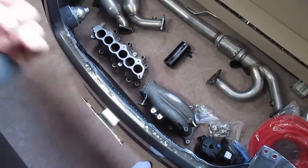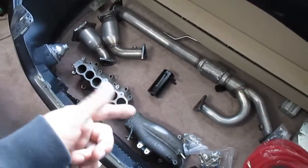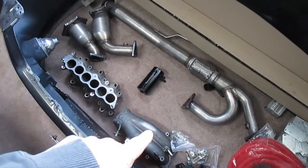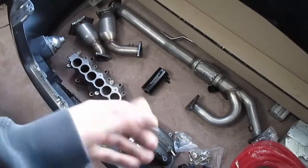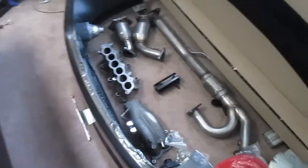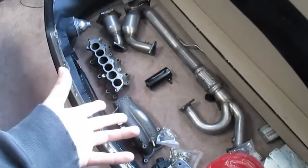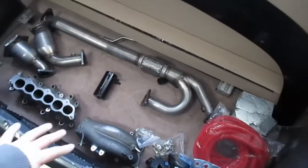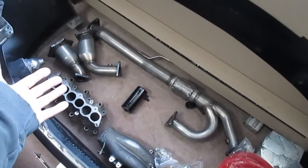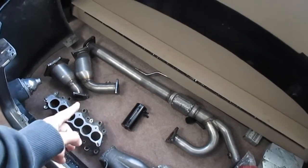Next up, I only have two-thirds of what I need here — the lower intake manifold and the manifold elbow. Still waiting on an upper intake manifold; I'm hoping to find one cheap locally. What I'm going to do — I've been looking online and a lot of guys do the manifold gut. They take out this little ridge, weld the plate so it's one solid elbow, and remove all the shelves from the upper intake manifold. I'll try to get that going, and if not, I'll send it away for the treatment. If I don't have the right tools I'll just send it out.